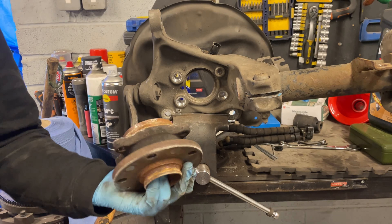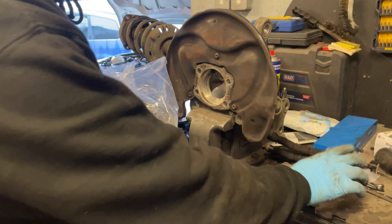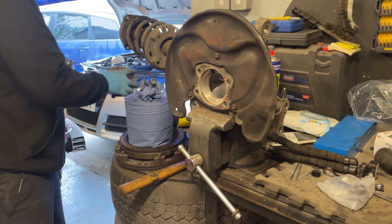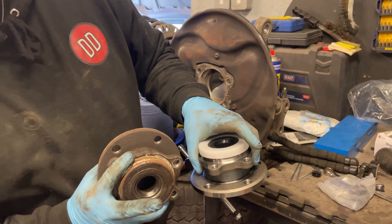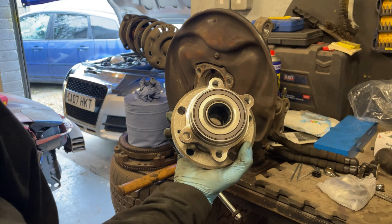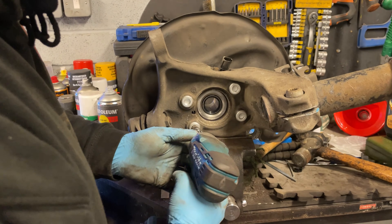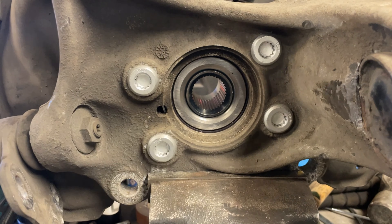Here's the new wheel bearing, and it comes with bolts — both the axle bolts and the four bolts that put it in. You can clearly see the difference between the old and new ones. That's 130,000 miles on the old bearing, so it's definitely time for a new one. To tighten these bolts I torqued them up to 70 Newton metres and then did a further 90 degrees to make sure they were definitely in there.